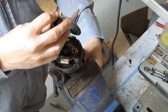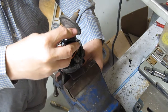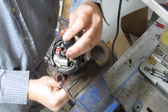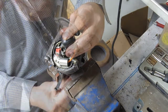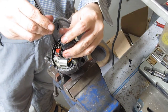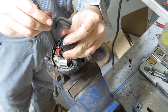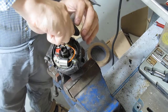Arrange it all to be well clear of everything before tightening. Now to set the points gap — there are a couple of notches that a screwdriver fits into to adjust the position of the points. Set it on the cam at maximum opening, then use a feeler gauge. A little bit of jiggling up and down helps you assess whether the feeler gauge is being pinched by the points, which is the position you want. Finally, just tighten the clamp.